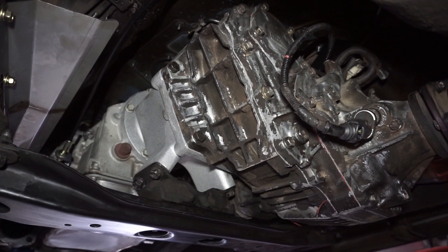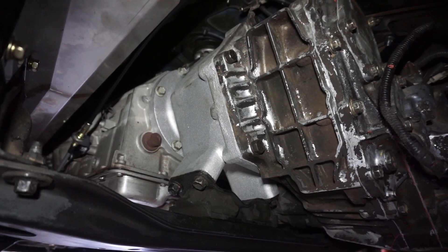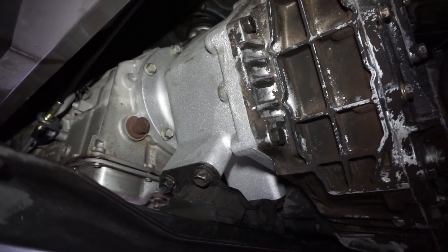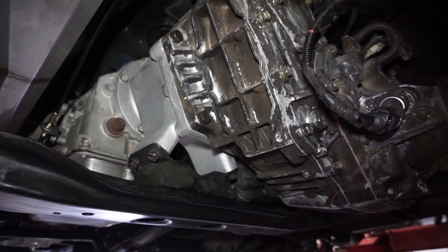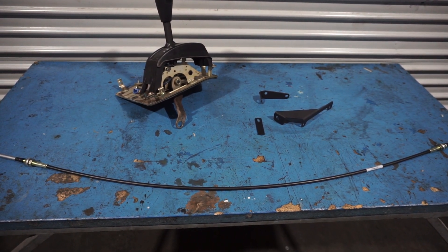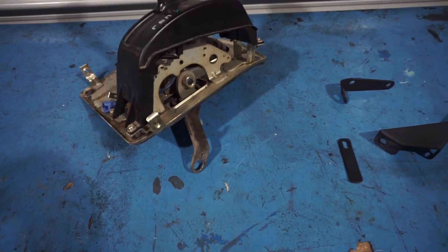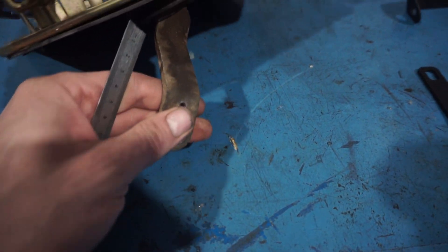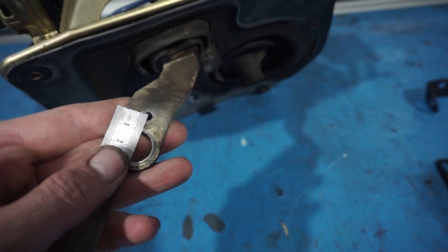I've got the motor and box in now. You can see the transfer case adapter just sits on the standard cross member and rubber. For the auto, we don't need to slot the cross member holes like we do on the manual. We've already got the shifter cable and bracket set up. For the gear shifter I like to retain the factory one because it just looks a lot neater inside the car, so I'll remove the shifter — the only modification is drilling a small hole.